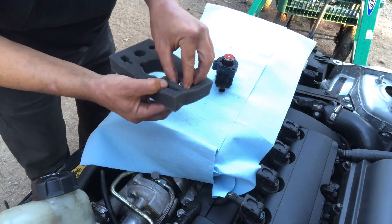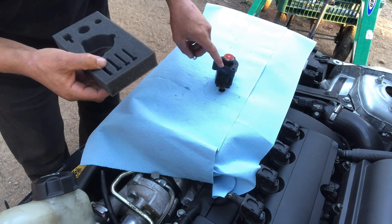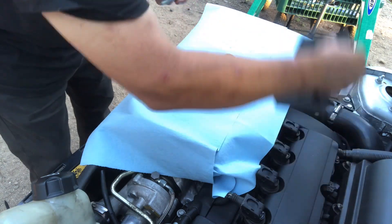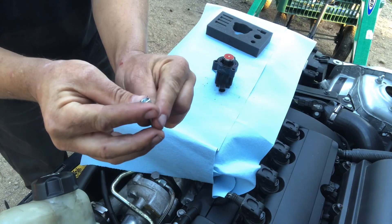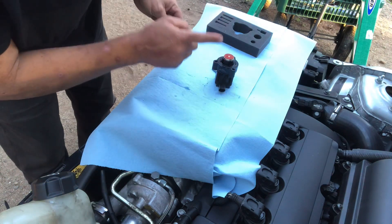The DV Plus comes with new screws that are longer to make up for this thicker piece, so you're gonna want to pull all those out. When you do that, you'll see there are markings on the end of the screw. I can't see what they say, but if your screws do not have markings on them, you have a fake DV Plus.